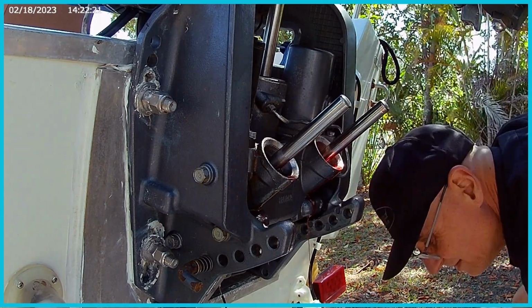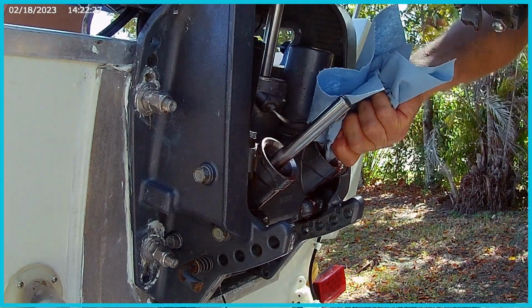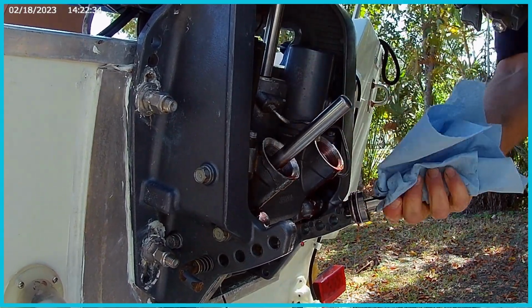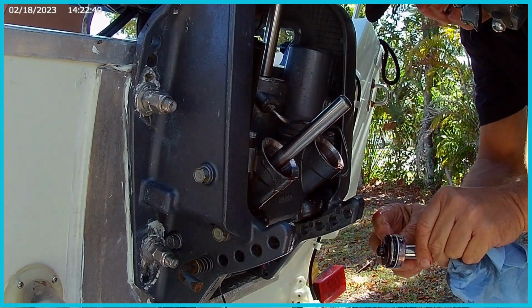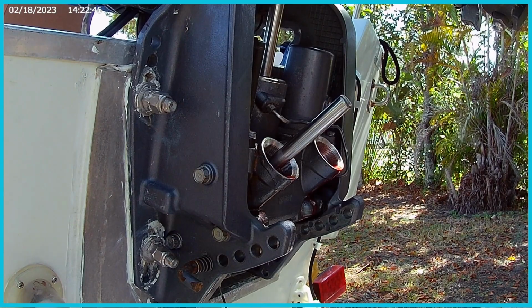They look fine, but they're not working. Alright, so now I'm just going to grab these cylinders and work them out of here. These pistons, I mean, out of the cylinders. Okay, so there's your piston right there, your little ram. And these are the seals that I'm going to replace right here. There's two parts to it, so we'll replace that. Okay, down there.